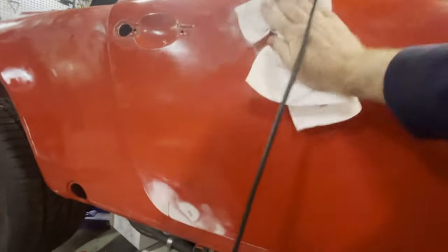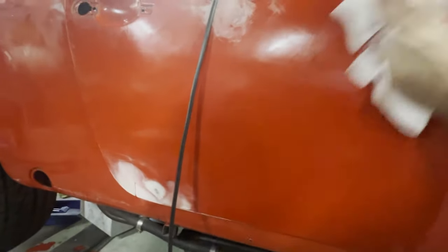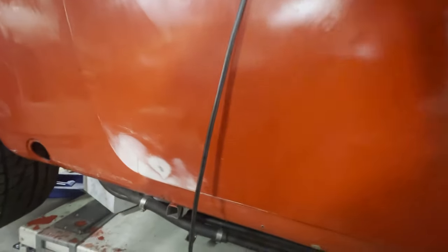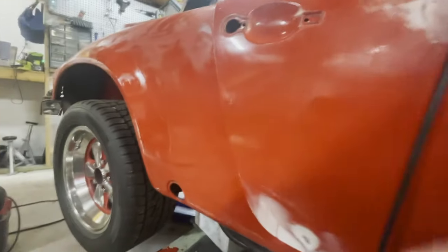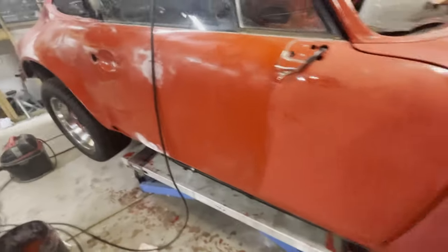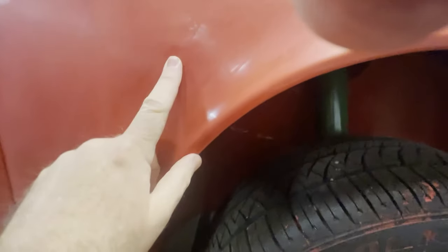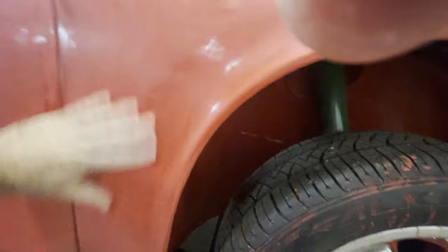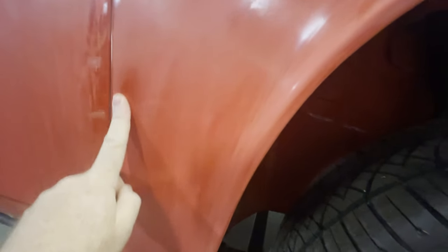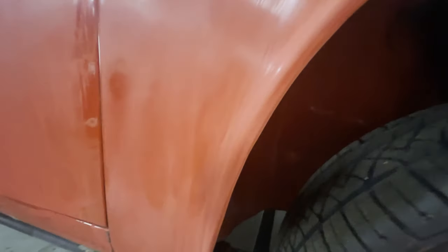Another thing that's helpful to do is when you're sanding, first just sand it quickly and lightly. Just go over everything just kind of briefly, and then wipe it down. And then once it's dried, you'll be able to see if there are any dimples, like if you got any dings that you just hadn't noticed. So once the body is flat again, you can tell, oh, that spot is a little shiny there. Is it just because I missed sanding it, or does it actually have a dent or something? For instance, right here, there is a little door ding. So you can feel it. So I'll try to correct that by just some more vigorous sanding, and if that doesn't work, then we'll need a little filler right there.